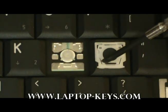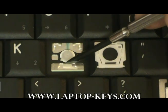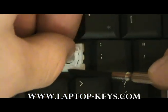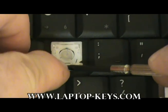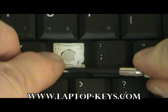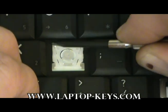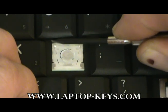Place this plastic bar underneath this metal tab first. You'll have to tilt the clip up a little bit to get it underneath the metal tab. After it slides under the metal tab, push down. Now push the bottom of the clip upward — push on the left and the right sides. That should allow these plastic pieces to clip under these metal pieces. Make sure you push down from the top on the left and right after they click in to get them fully underneath.